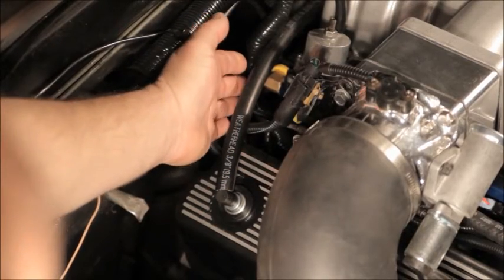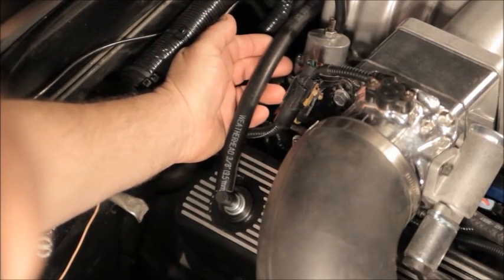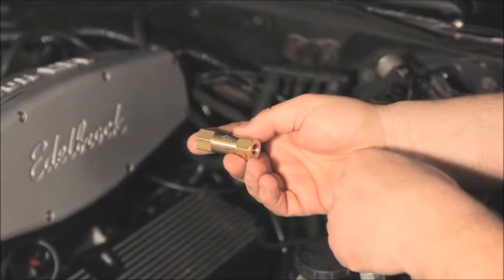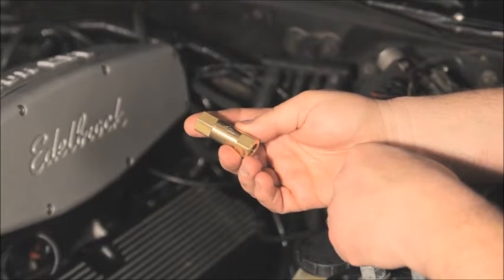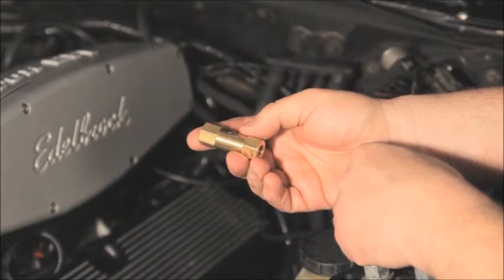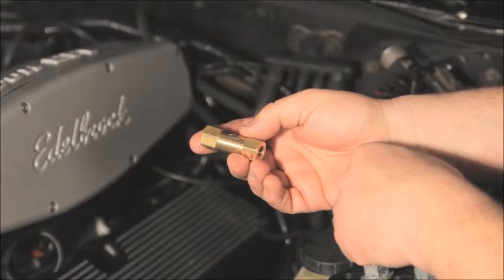The third one should be connected to the PCV valve only. With forced induction, there will need to be a check valve in this circuit to prevent boost pressure from entering the crankcase. It's a common myth that you can use a PCV valve from a production vehicle with a turbo or a supercharger and not use the check valve. Don't do it. These PCV valves, especially the aftermarket ones, are unreliable at best for this purpose. You must install an inline check valve if you're using forced induction. The direction of flow needs to be toward the intake manifold, of course.